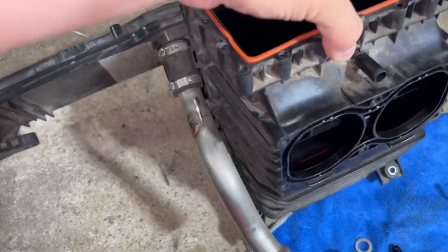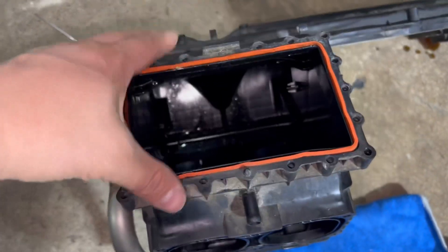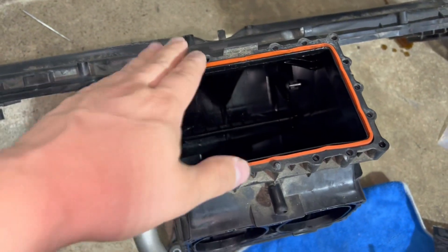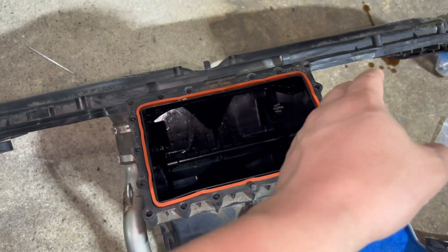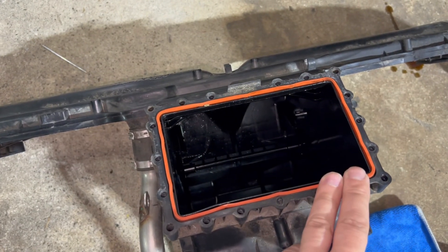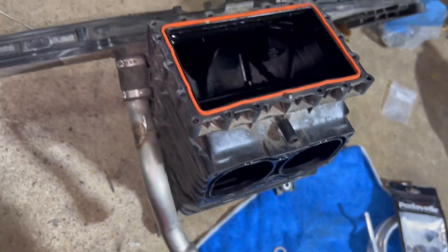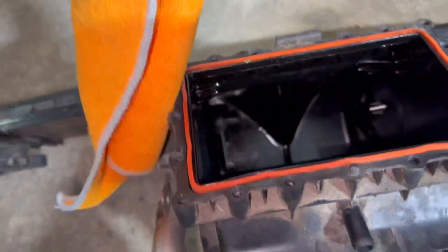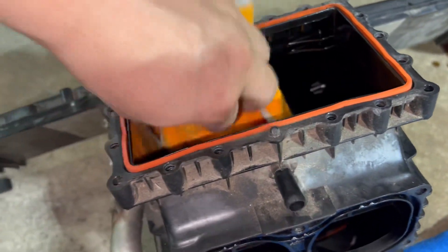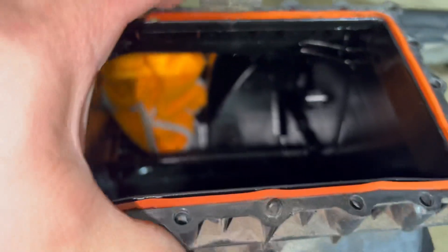This is your intake box, which is very easy to work with. You just put the two clamps to isolate the water coolant, disconnect from the intercooler, unscrew the bolts, and pull it out. That's the first step. Second step: cover up those inlet holes — put a piece of paper or rag there just in case nothing flies into the engine while you're working.